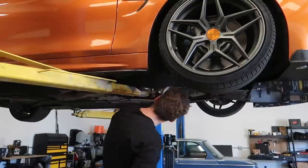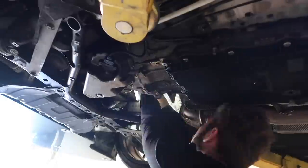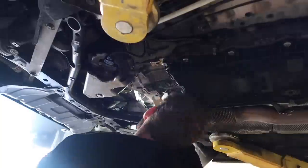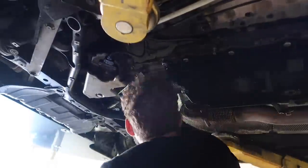Installing it looks like it's going to be a lot harder than I thought. I'm going to remove this screw here and a few screws over here so I can get my hand through - I think that'll help a lot. After working through it: I've gotten everything as tight as I can. The downpipe is in. Now I just have to route the wires up, put back all the heat shielding, and reinstall the bracket. I'll do a time lapse and get all this done.